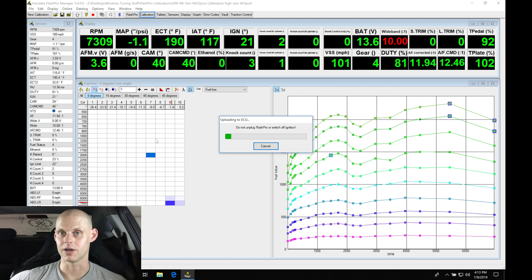Give us the broadest torque possible - we're not going to be leaving any torque on the table. Having a nice smooth blend, we need to verify that first, then we can work on our VTEC engagement point. So let this flash and then we'll evaluate it and keep moving on with the video.